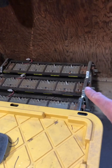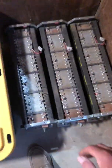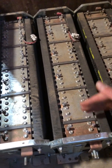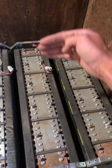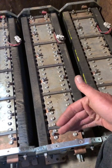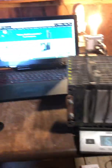We've since put in one of these — those are 36 volt. I actually just bought these off of batteryhookup.com and they were already pre-built, which I really liked. I just didn't like paying the shipping to get them here to California from Pennsylvania. But these are basically three times that: that's 20 cells, this is 60 cells — so one of these is 60 cells. Instead of a 20-cell configuration, this is a 6×10 cell configuration. That's what that battery is and that's what I got in that cart.